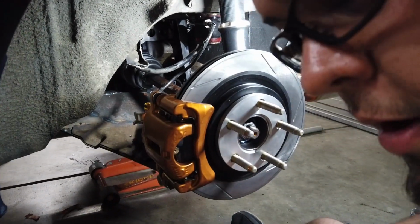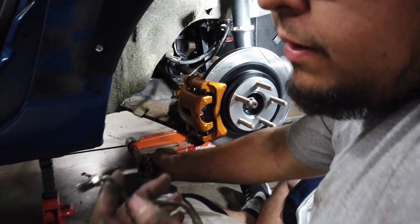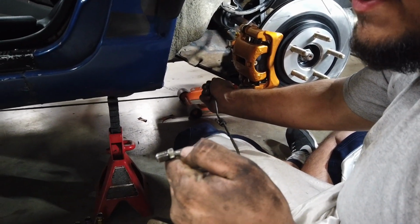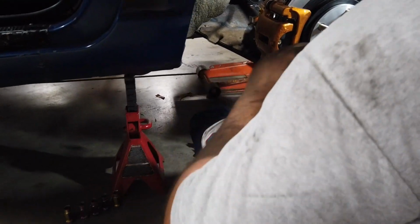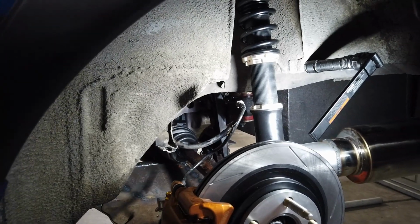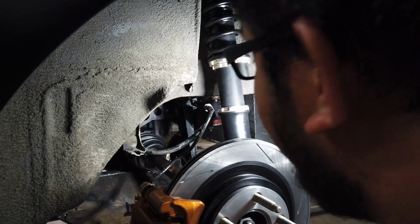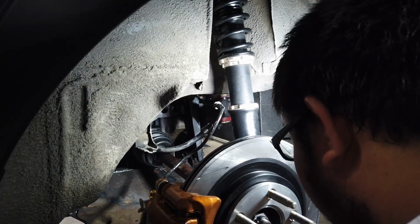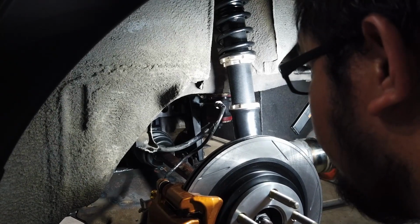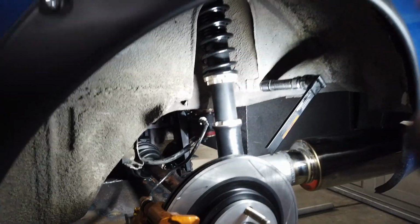Here's our original 1974 Datsun 260Z brake line, and we found there is a little crack right there. So we couldn't bleed the brakes. But, lucky for me, I hoard stuff. We got a brake line from a 1997 Yamaha Banshee 350. Bent it straight, went right in, look at this. And it's the same fitting, the same thread pitch, all that fun jazz. Being Japanese and all.